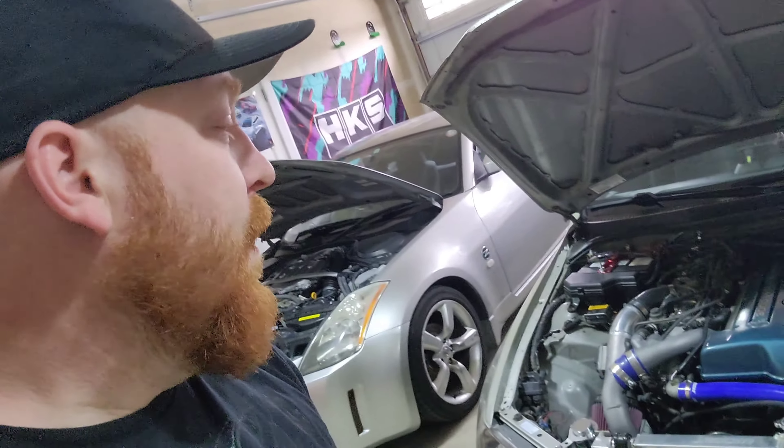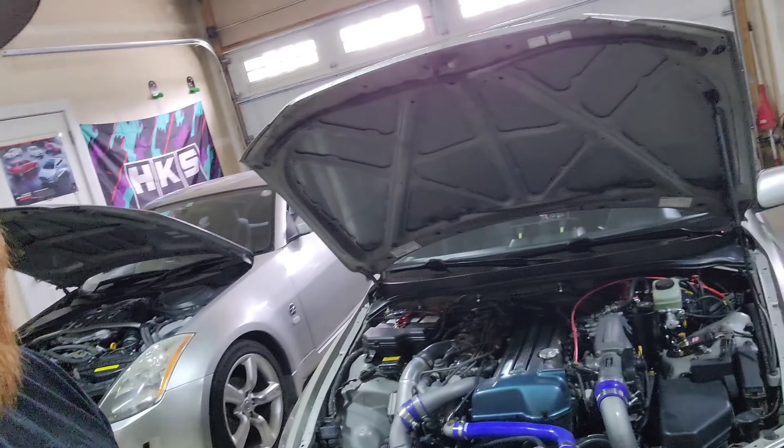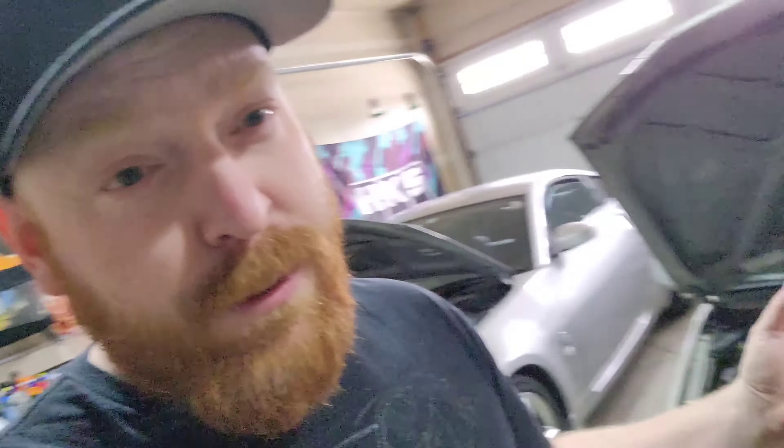One thing I did want to show you guys — the hood insulator is gone. I've been running this car fairly well. It's been running about 195°F on the highway, which is perfect. When you're stopped in a drive-through or chilling with friends in a parking lot, it kind of creeps up to like 215–217, which is where I don't like it. Anything over 220 is technically overheating. This thing hasn't reached there yet and I don't want it to. Online on the IS forums, they say that people have dropped 30 degrees. So running right around that 195 mark at most times — that's where I want to be. 195 on the highway just tells me my cooling system is working properly.